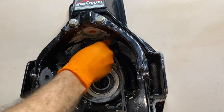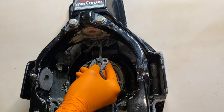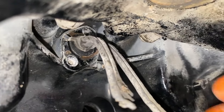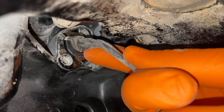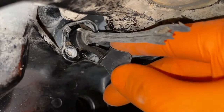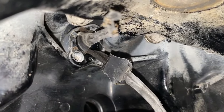I'll continue pulling the plate out and down, the wiring just like that. When it comes time to reinstall this securing clip or plate, the slit has to be basically on the left side at the 10 o'clock position. I'm going to reach my hand up in here, grab both wires — you'll notice this little rubber boot that serves the purpose of creating a watertight seal. I'll carefully pull that out. There are two halves that create that rubber grommet or seal that goes inside that hole.